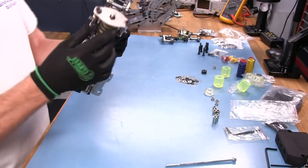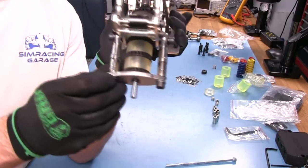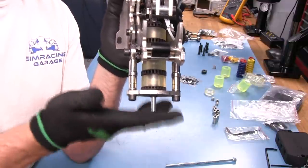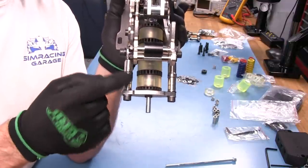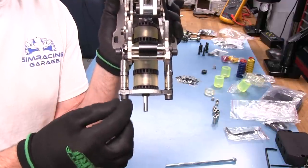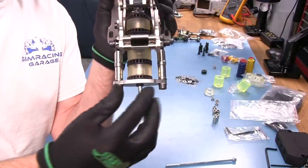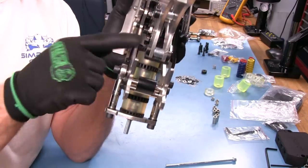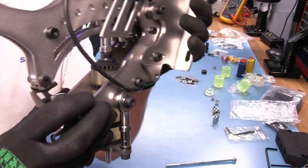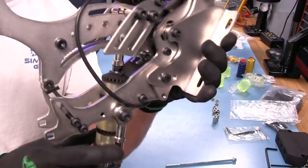Okay. So first thing is, how do you change this stuff? Well, the whole deal that you're going to be focusing on here is this right here. These rod ends on both sides and the spacer stack that we have in here determine the preload on this pedal. If I've got too much preload, it's too stiff right now, then I would put some shims in here. And then the bolts would obviously not go in quite as far. If I put shims in there, it would make the reach longer so it wouldn't clamp as tight. And that's how the preload would be adjusted. There's no preload adjustment up here, unless you want to put some more washers on top of this plastic piece. You could put some more washers in there, but then you've got to take the whole stack out anyway. And yeah, probably just easier to use this.